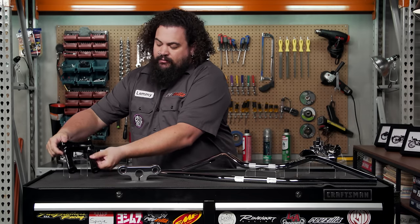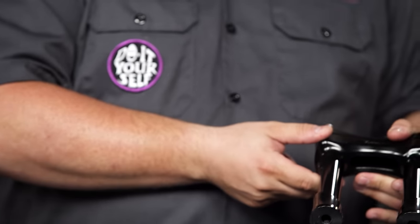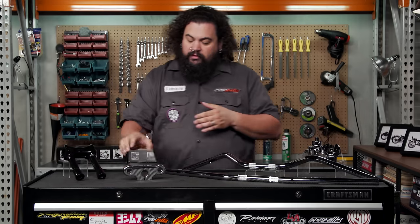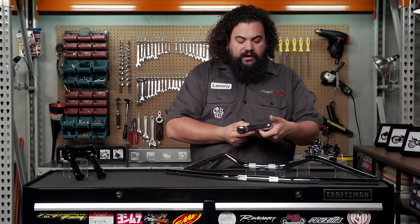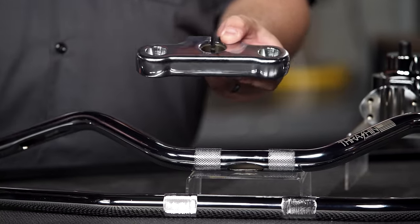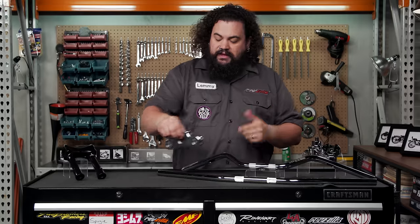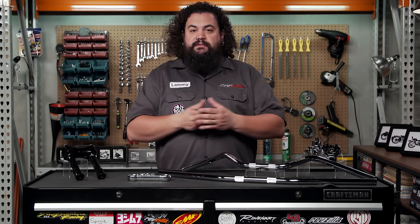Here's what I'm talking about. We've got a set of risers here specifically for a hydraulic setup — note the spacing is three and a half inches on centers. If we hold this up to a set of regular hydraulic handlebars, these things line up beautifully. However, this won't work on a Springer. What we're looking at here is a Springer top clamp — center to center distance is actually four and three quarters inches. If we held that up to that knurling, it's not going to work. These bars over here, on the other hand, match up perfectly because they're specifically made for a Springer. The lesson: if you have a bike with a Springer on the front, make sure you're ordering bars for a Springer as well.